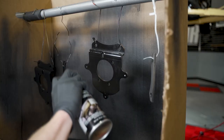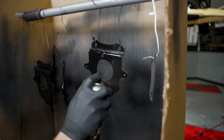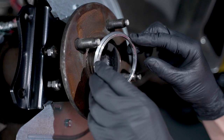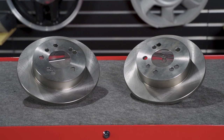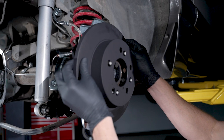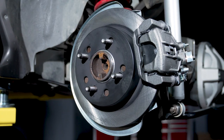In order for the new calipers to be bolted up correctly, we include the correct caliper adapter brackets that complement the new caliper and the 10.5-inch rear rotor. Also included in the new kits are hub-centric rings for the brake rotors, since the SN95 axle flange is a tad larger than the Fox flange. The hub-centric ring will properly center the brake rotor on the existing Fox axle. The rotors are brand new 94-04 V6 and GT units that have been precisely re-drilled to accept the 4-Lug Fox axle.